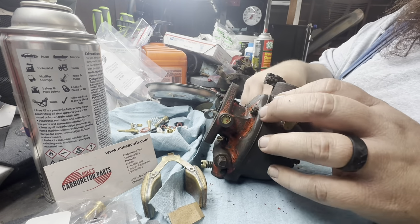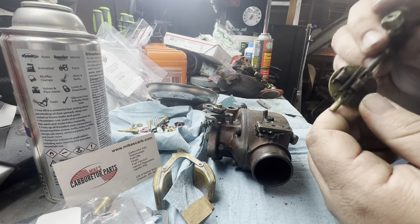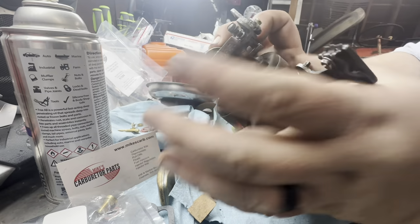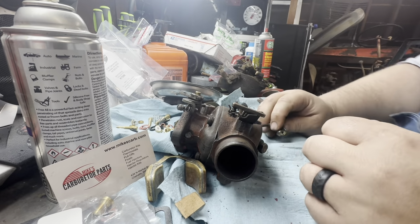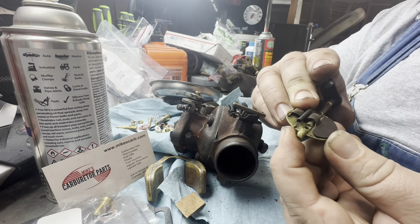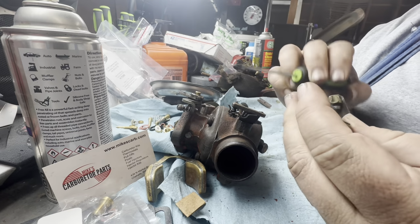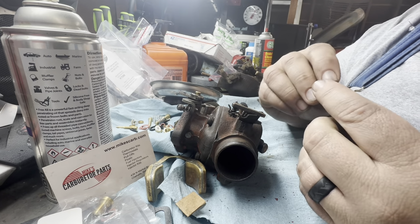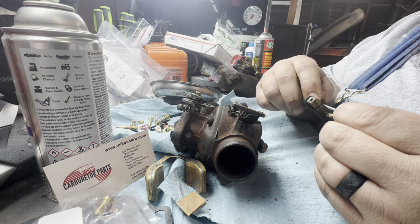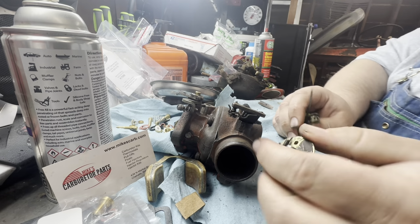That's still clean. These are always kind of fun, because I've always called it a backfire protection. Essentially, if you have your choke closed, it's basically like blocking the front of this, like you block it with your hand. If the choke was closed and the engine backfired really bad, and it didn't have this little spring device that snaps forward, it would try and find another place to go boom. And you don't want it to go anywhere other than right there, because it could be the intake manifold or the carburetor, things made of metal that you don't want evacuating places. So that's what that's for, which is why this has to go in like that.